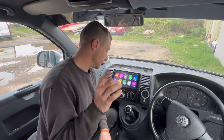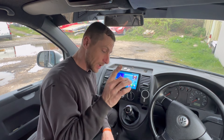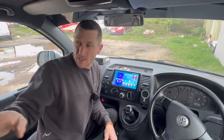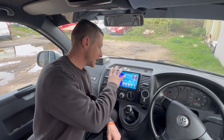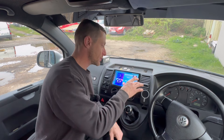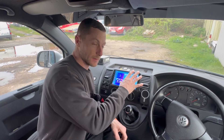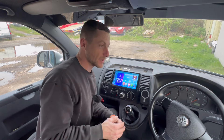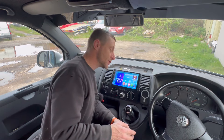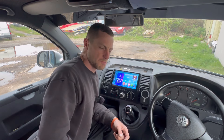I can't rate these stereos enough. I'll put a link in the video description. Don't buy a cheap one because they're cheaper for a reason. About the stereo - I'm going to quickly show you the sub and amp and then the reversing camera. It's not the biggest video today but just a little video because I see a lot of people asking about fitting screens into a T5, and it's really simple. Once you've cut your aperture out, the stereo fits in nicely. Cable tie in the back. You do have to join the wires unfortunately as there's no ISO plug unless you buy one. Because the missus was like - aren't you a bit old for that - but these stereos are absolutely brilliant.